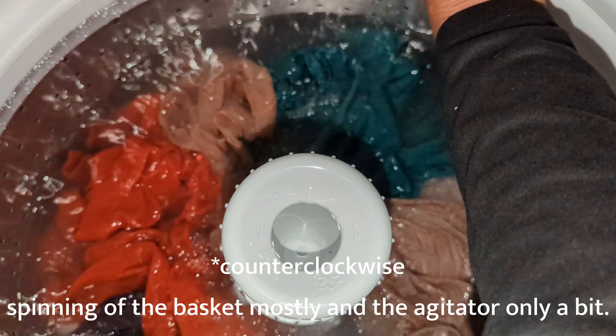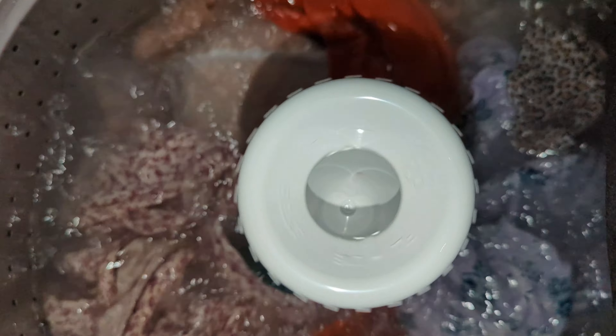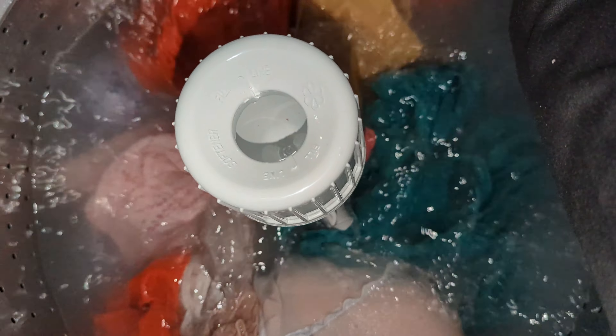See, that's the tub index — the tub is spinning counterclockwise, but the machine works correctly. That's a 200–210 degree agitation stroke, doing a good job getting these clothes rinsed.